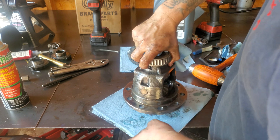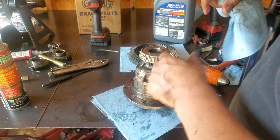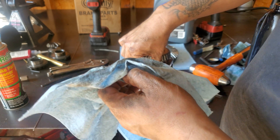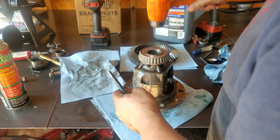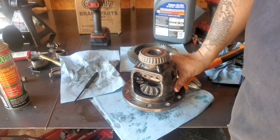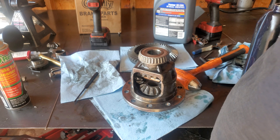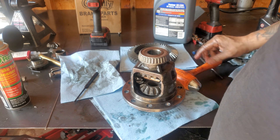Now that they're in, I'll spin it around. There's the pin holes right here, here's your pin — we are going to go ahead and drive that back in. As you can see the gears are in, they spin nice and easy. I also checked the ring gear — made sure there was no wear, no chips or anything on the ring gear itself. Everything looked good.